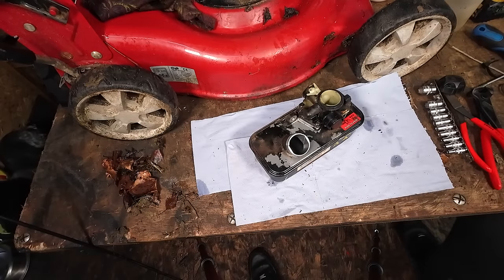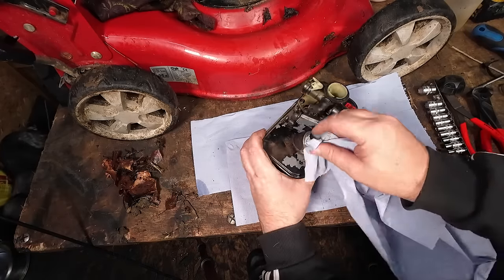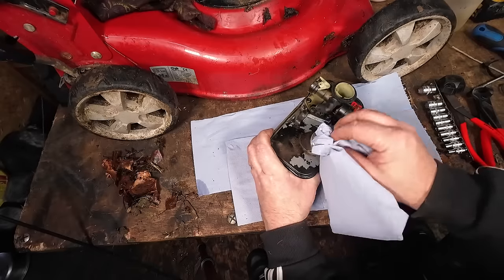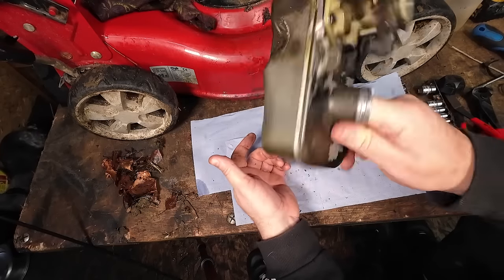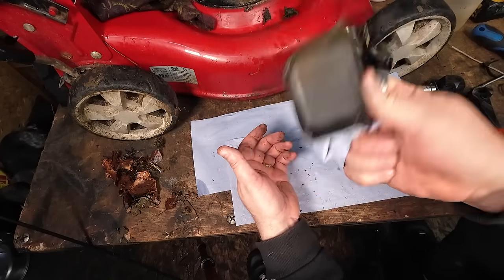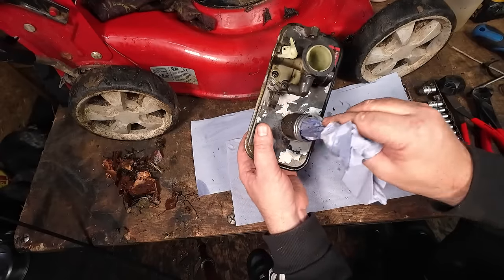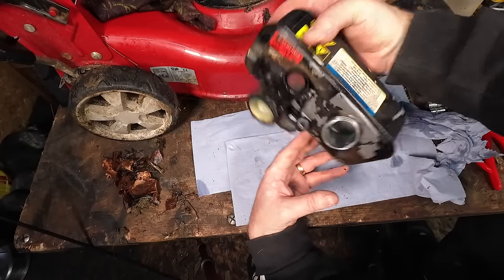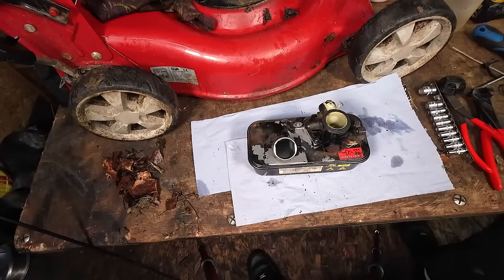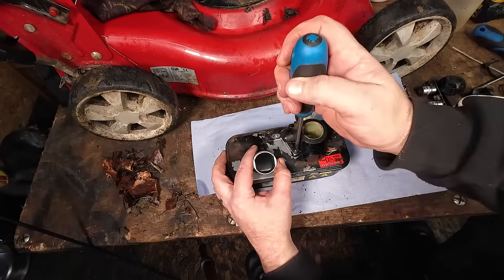Tie a latex glove on over the fuel cap like that, and on your air filter as well - once that's all screwed into place you can stretch the glove over the top of the whole air filter cover. With one glove over your fuel cap as well, that will stop the majority of moisture. Alternatively, cling film, a carrier bag, a plastic tub - anything works. But ideally get it indoors and out of the air moisture altogether.